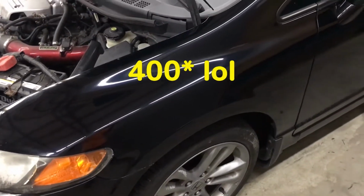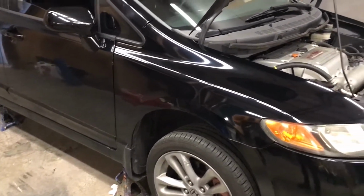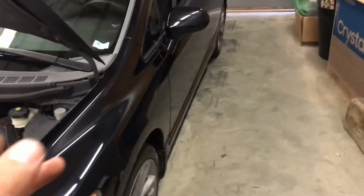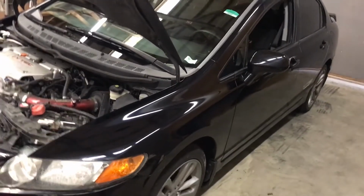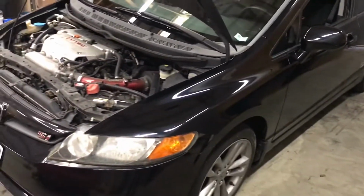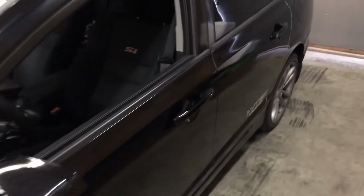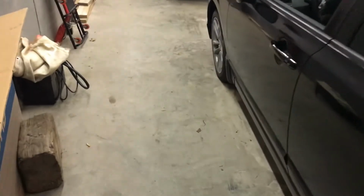After I'd gotten back, I hooked up my OBD2 scanner, and it has an ABS feature on it, so it will show me any ABS codes. It also has OEM advanced OBD readouts, so I can check for pretty much anything I need to with that scanner. I ran the ABS scan on it, and it popped back with a 65-01 code, which lists about 5 different things.